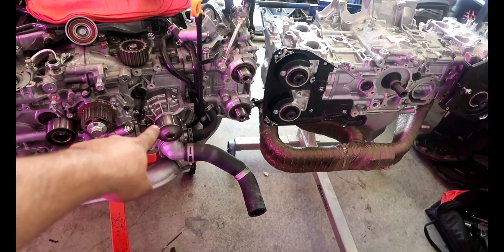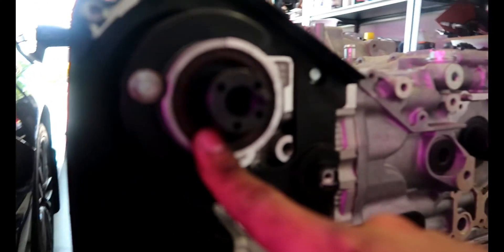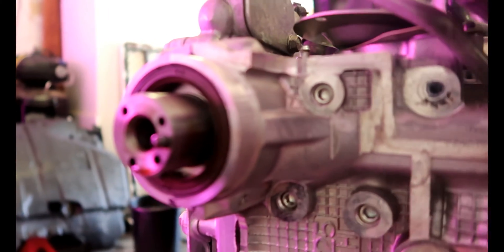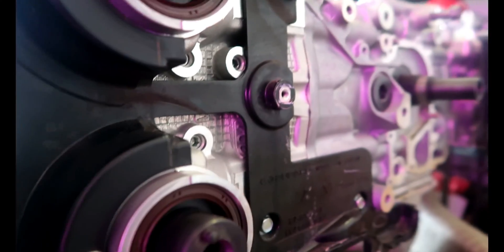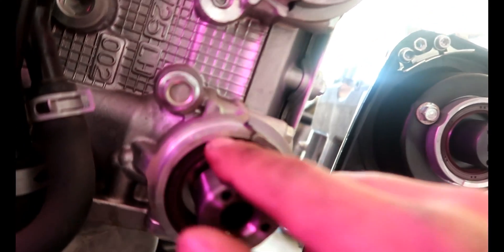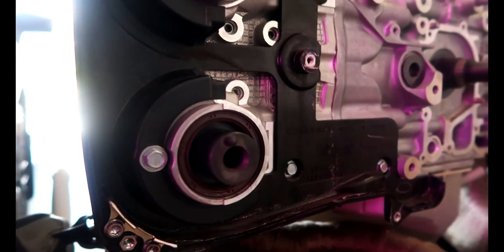I'm going to take all the bolts from the water pump. I don't like how they assembled the long block — they pushed these O-ring seals in too far. It's supposed to be flush, not pushed in like this one. I never push them in this far; I always have it flush if I can. So I'm gonna have to take these out and put new ones in, because there's no way I'm saving them. Plus the gasket kit comes with new ones anyway.